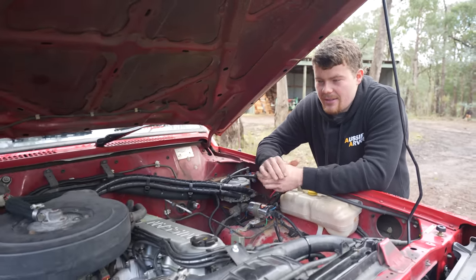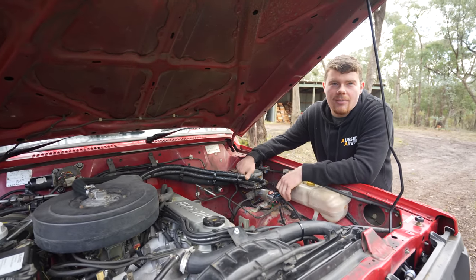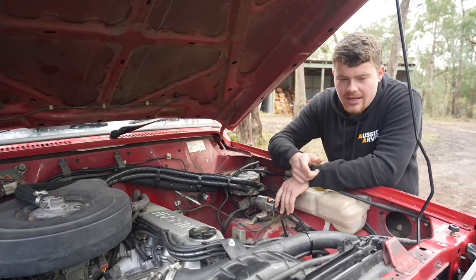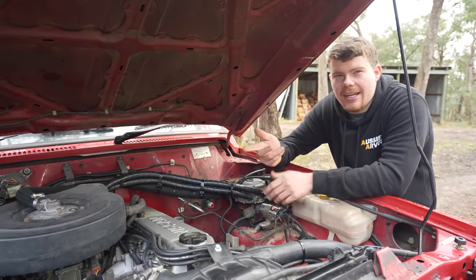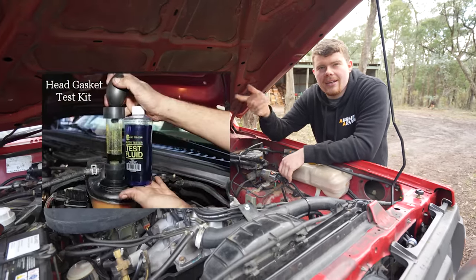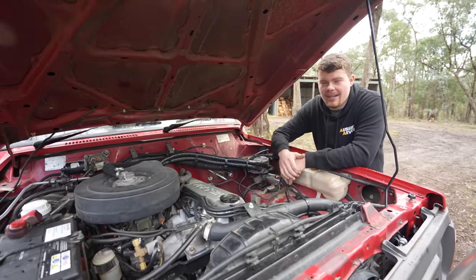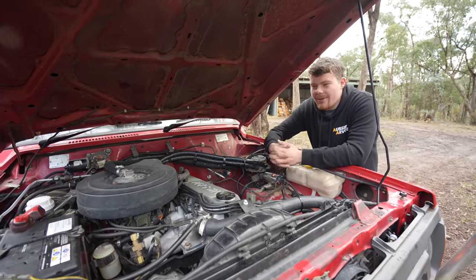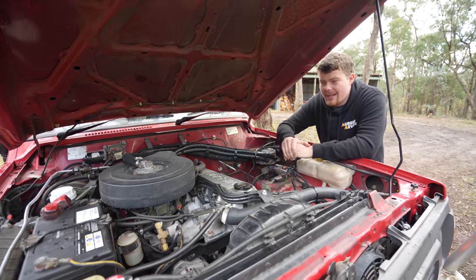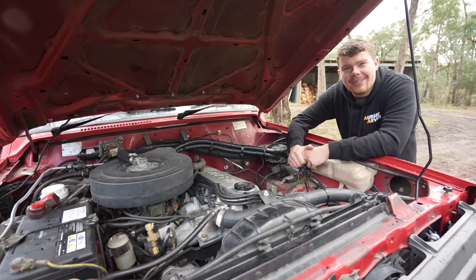I chased every other thing I thought it could be. I thought it might have been the gas converter — they have a cooling jacket, so I thought it might have been leaking high pressure LPG into the cooling system. Wasn't that. Checked everything else, made sure the fan hub was working. Eventually I did a chemical head gasket check — you put it on the radiator, run the car, and if there's any products of combustion coming out as a gas, it changes colour. That didn't show anything up. I ran it for about half an hour on about two grand, nothing coming up. It was only under load. Eventually I had to bite the bullet and go — I really hope it is a head gasket — and take the whole thing apart.